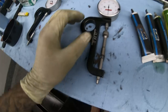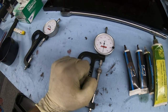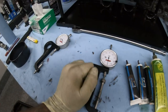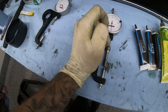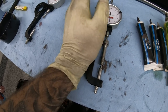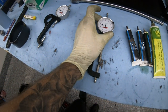You zero the gauge out when the fastener is loose, then start at the lowest torque value the manufacturer gives you — let's say 45 foot-pounds. You torque it, put the gauge on there, and the bolt will have stretched. In the case of these Carillo bolts, they say don't exceed 58 foot-pounds and you want to be within five to seven thousandths of stretch — five being the minimum, seven being the maximum.